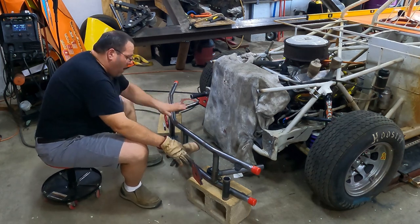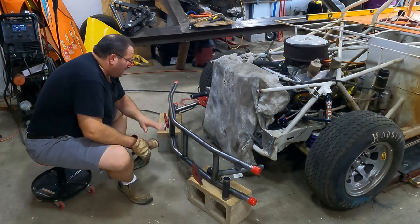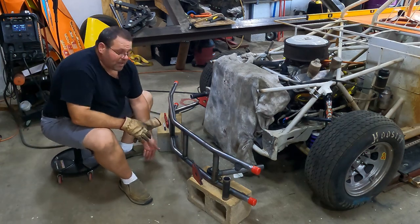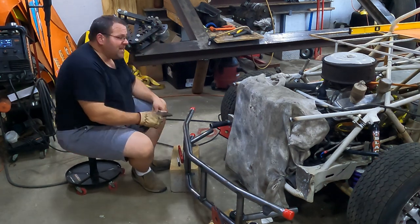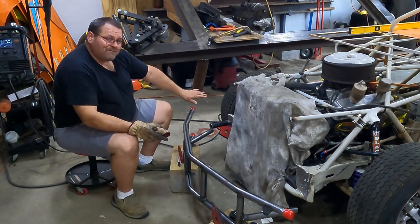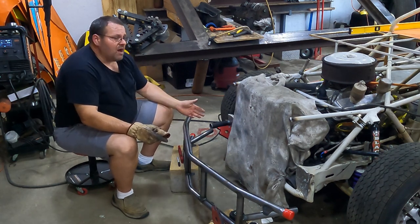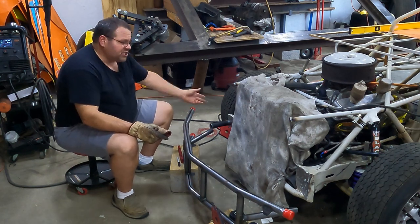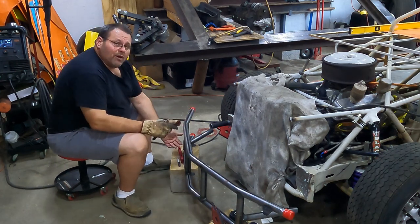I've got my nose sitting level on my concrete blocks. That's going to set this nose at about six inches on the bottom — that's pretty low. The rules in crate racing will allow me to go all the way down to five inches, but from experience with a car like this, at five inches I will just fold all that up underneath the car. You don't have that clearance when you're running up against a cushion on the high side, or if the track's a little choppy and rough — you'll just tear it all off at five inches. Realistically, six to seven inches is where my real minimum is.